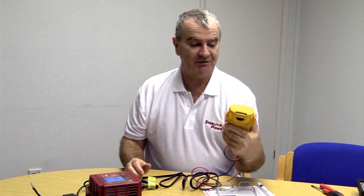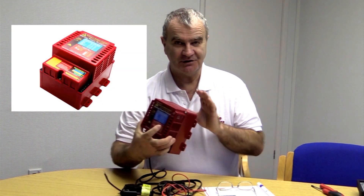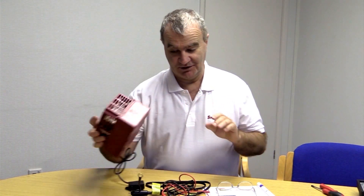Now just go for a drive up the road — have your mate sit in the car beside you and you should notice it goes up to about 14.6, 14.5 volts. Drive up a dual carriageway or a reasonably straight road, and if after about 3 to 5 minutes the voltage drops down to around 12.4 volts or around that area, then you've got Regenerative Braking and Smart Alternator, so you need to be looking at a trickle charger to cure the problem associated with that.